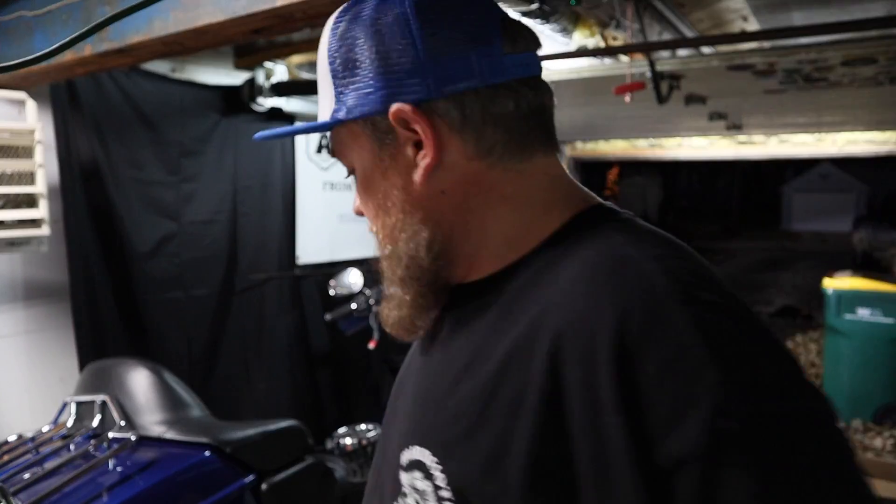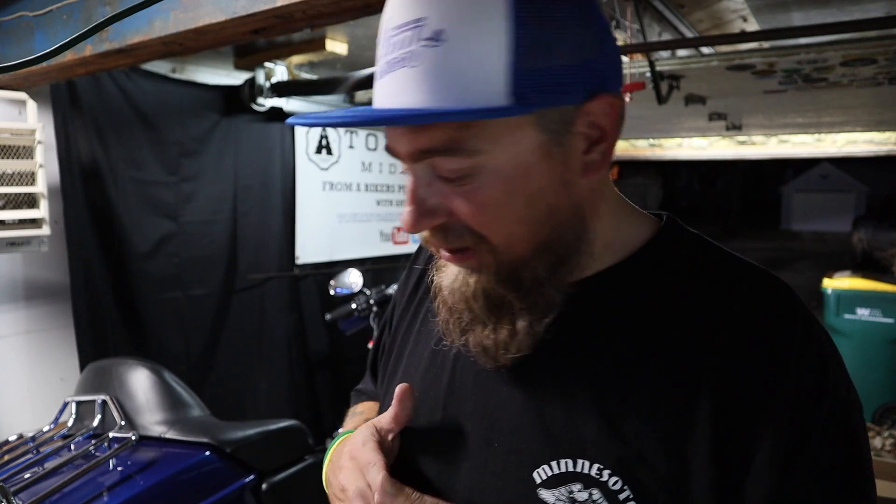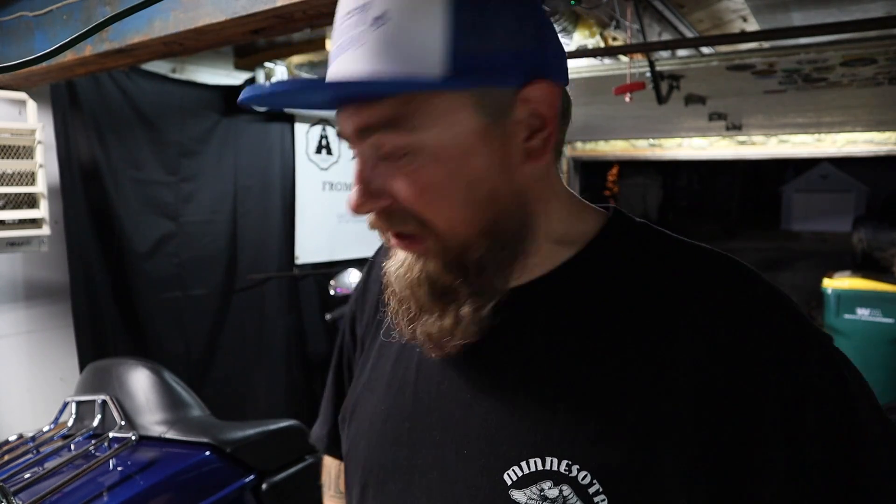I've just got the coolers running right now, trying to dry out the vents a little bit. I did have to run it and blow some of the water out of the exhaust, so there's not just water sitting in there. Now, if your bike is like this one and it has liquid-cooled heads, we need to check the radiator coolant. I have to get a tester, so we're going to skip that for this video. I just want to make sure that the freeze point is still good enough where it's not going to freeze and crack my heads — otherwise we'd have to do a coolant flush.